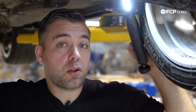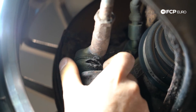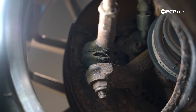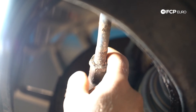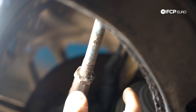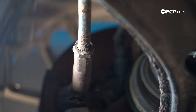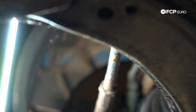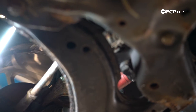Now we've got the car jacked up in the air. We're going to work on the driver's side because you get a better angle of the outer tie rod boot. I picked this side because the boot is really badly torn — an obvious indicator that you should replace the outer tie rod end on a car this old. If you look at the threads here, they're really rusted out, so you'll have a hard time unthreading the outer from the inner. The inner tie rod is going to be just as old and worn, so again — replace them in sets. Also, on the inner there's a bellows boot, and if there's any type of rip in that bellows boot, you'll want to replace the boot as well.